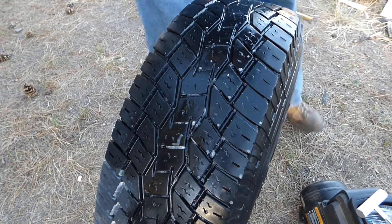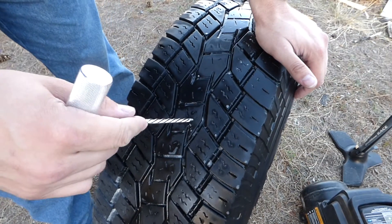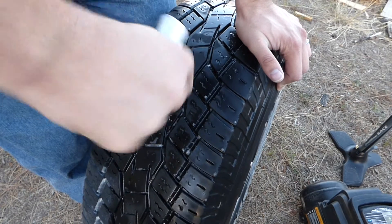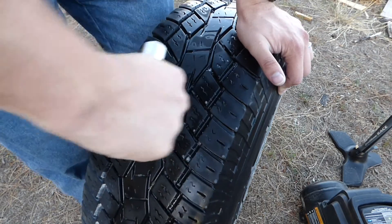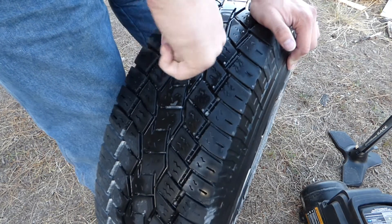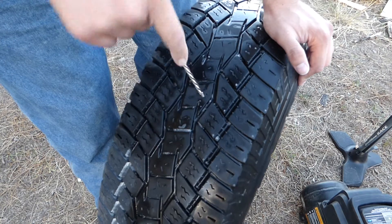Don't want to have anything shooting out at me. Got most of the air out — it's got a little bit left, but I think that's good enough. Let's go ahead and ream this hole. The reason we're reaming this is to scuff up the puncture so that the plug can adhere well to it. I've got it plenty far in there now — probably an inch or so into the tire. That's going to be a much worse hole than it was, but the plug should fill this up quite nicely.